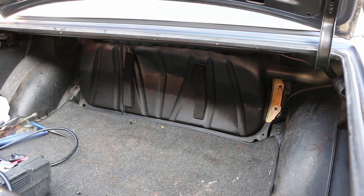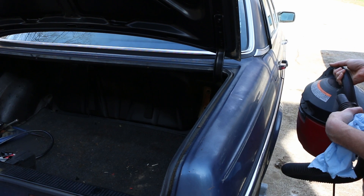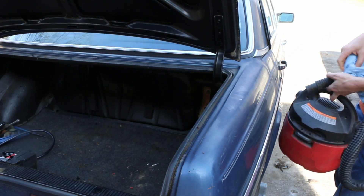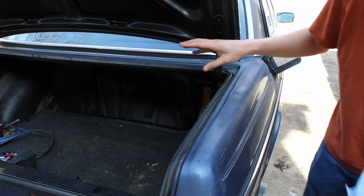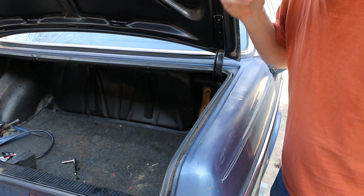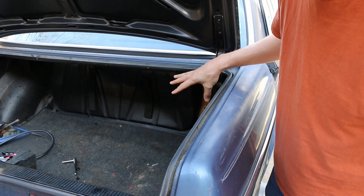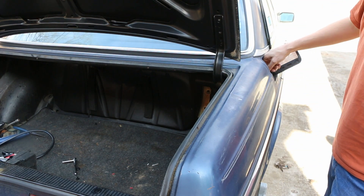Let me move you a little bit so you can see everything and we'll give this a try. Essentially, I've got a wet-dry vac on the blow side, and I'm going to take this, put it in the fuel filler, wrap a rag around it so it seals up a bit, and see if we can pop this out. This is also a great way if you're dealing with a fuel leak - putting a small amount of pressure in your tank can help you narrow down those leaks. You don't want to put too much pressure - I don't want to use air compressor pressure because it will just rupture the tank. Only a couple psi is all we're going to need, just enough to pop this thing loose.